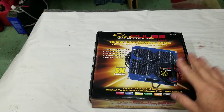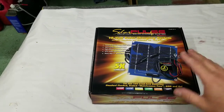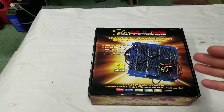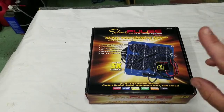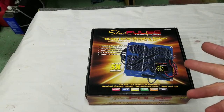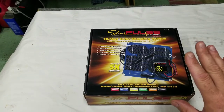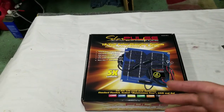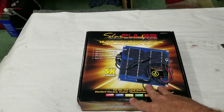The reason I'm going with an upgrade is that the trickle charger coming off the main truck wiring harness that runs my trailer lights does charge the batteries, but not enough if I have to make a few dumps in a day, especially with a heavy load. It runs two batteries for the hydraulic pump, and running that a few times a day really wears the batteries down. So without going to a hitch place or RV place to upgrade my trickle charge coming off the truck, I'm going to go with this solution and give it a whirl.